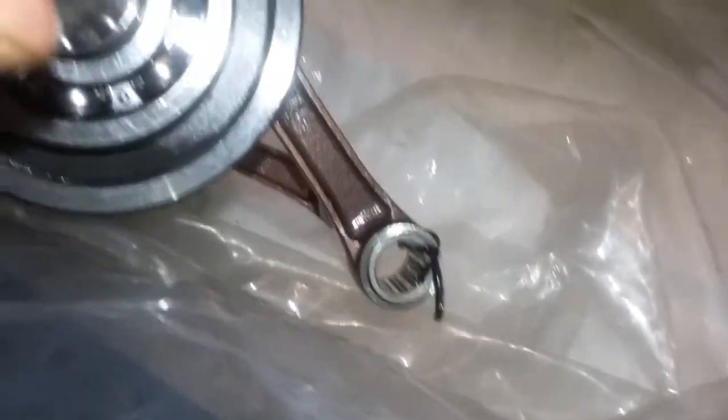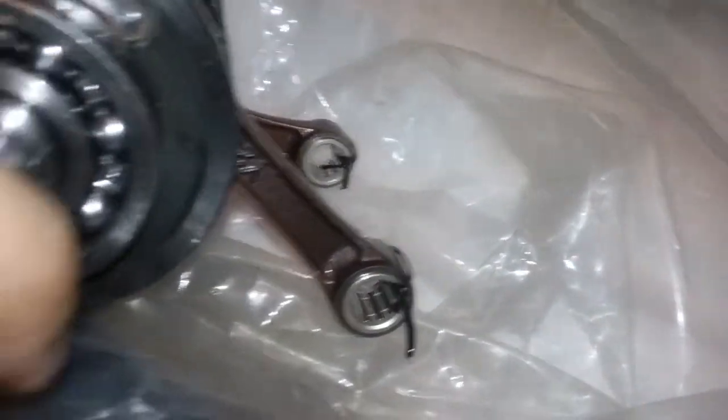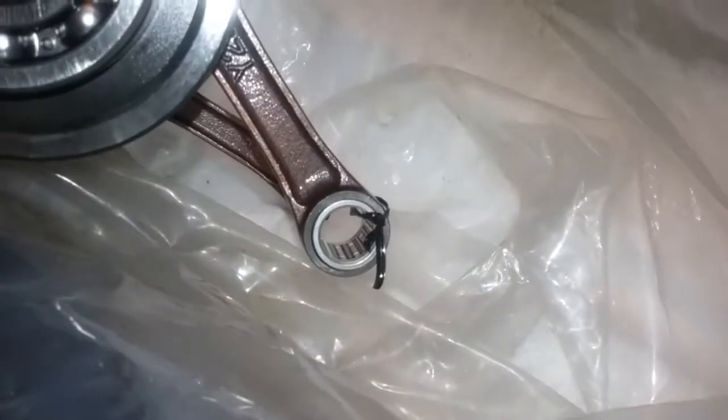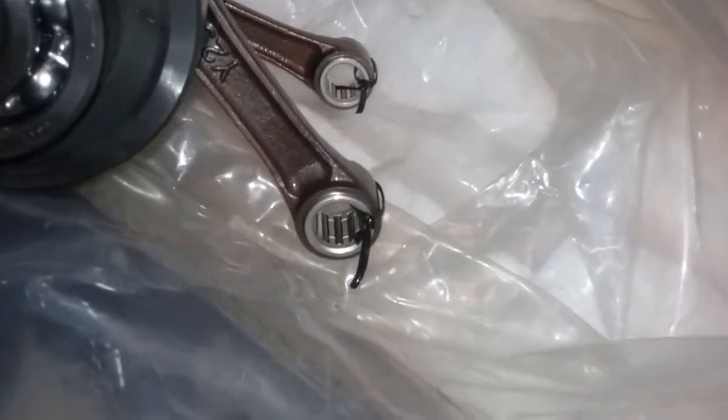This looks really good like that. Look how thick the connecting rods are where the bearings sit. I think these are probably either aftermarket, with connecting rods with the stock number on it, because my stock crank does not look like it — it's way thinner in between the outer edges, really thin right there. So I'm thinking that the crank that's in the Banshee is probably the original one, and these connecting rods on this are probably some kind of aftermarket deal.